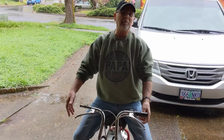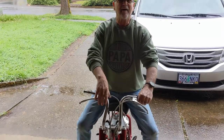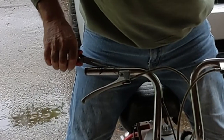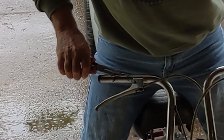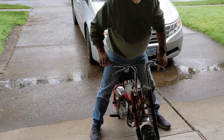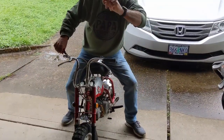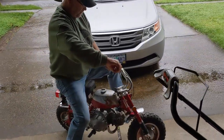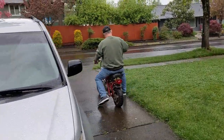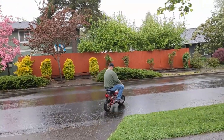Yeah. I mean, you bought a spark plug, I would put it in. Yeah, oh yeah. I don't think you're gonna do anything with the points. It just hasn't ran in years. It's just getting worse and worse. But here, try to rev it a little with the throttle. Wow. You adjusted the mixture or the idle? The mix. I turned it a half a turn counterclockwise. Oh, God. That takes skill.